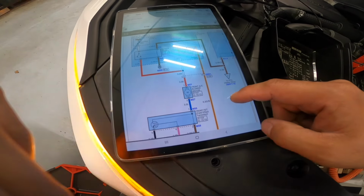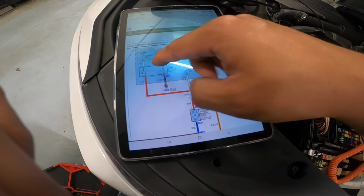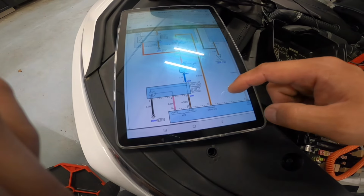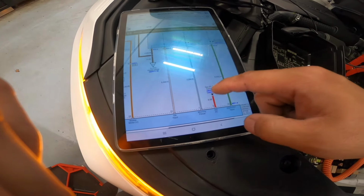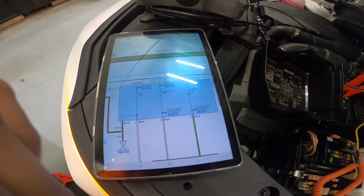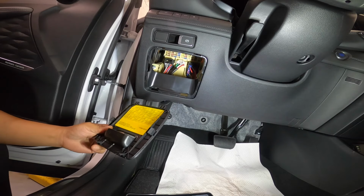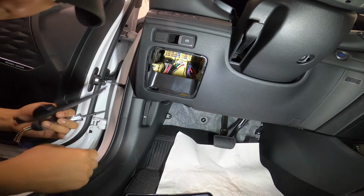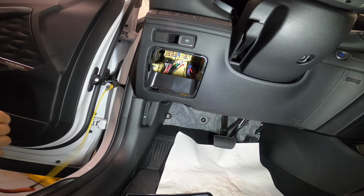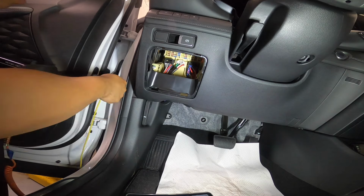GE02. So I should not be worried of GE02, because you should not get power there if a relay will not work. So we're gonna go inside and check our fuses there and see. Okay, so I'm gonna be looking AC 7.5, module 9 and module 6. So put in the ground there. Let's see if we have power. We have good ground.